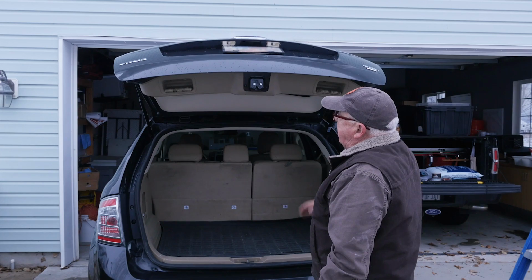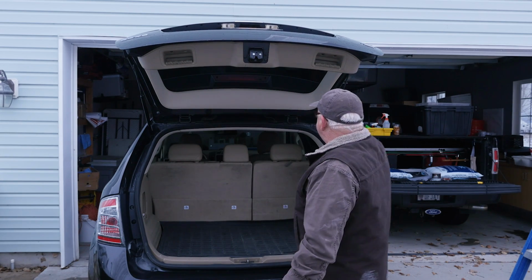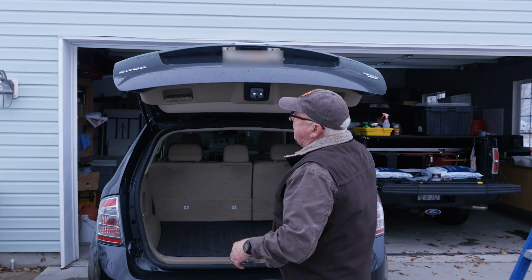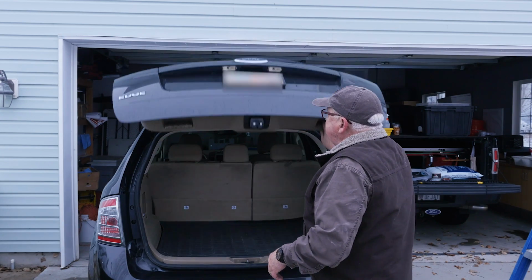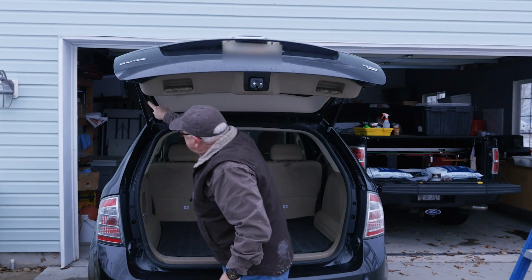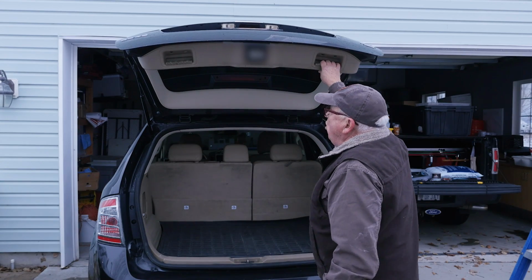As you can see, it's in the upward position. This is the dampening effect of, there's a valving system in both of the bodies of these lift supports that push the gas around so that you get that nice gentle lift once it's over past center. And as we close it all the way down, then you can feel it give, and the head of that cylinder body is down lower to keep that seal wet. So this is ready to go.